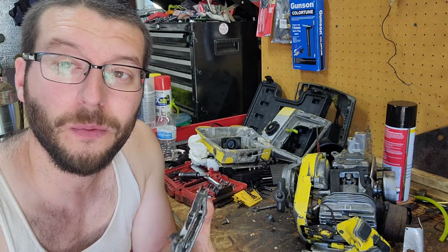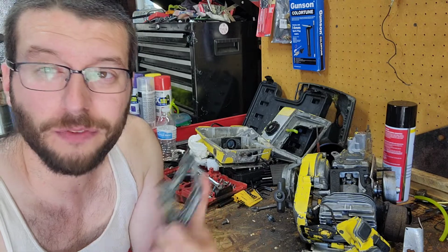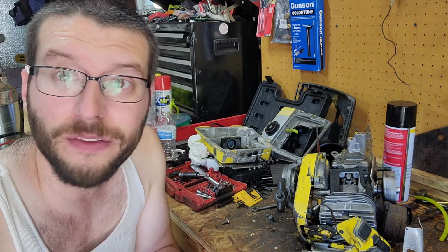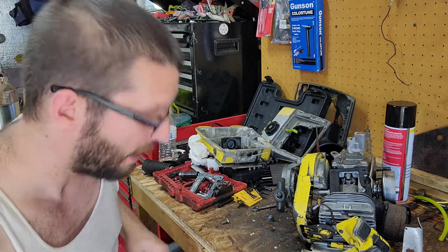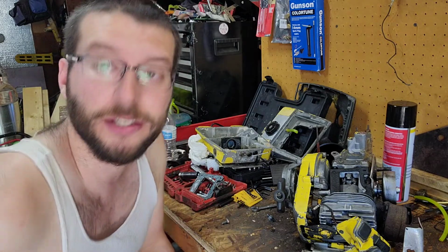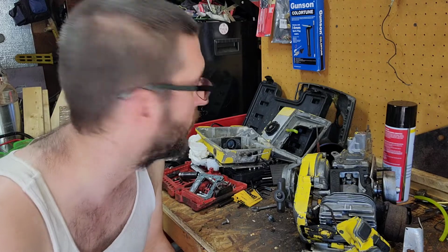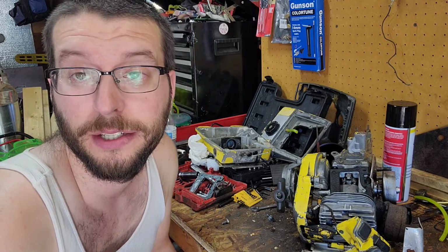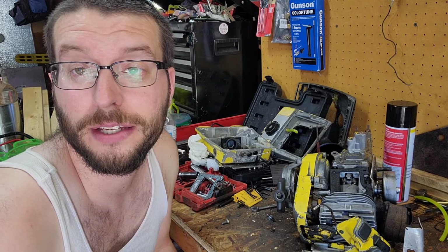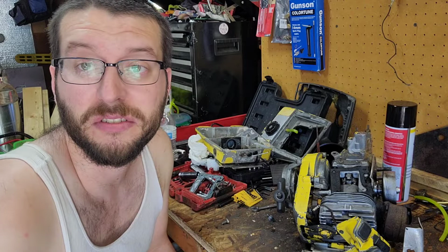The Velcro Care Pack one, it peeled off. But it's a little stronger type of fiber, and I didn't detect any leaks around it either. So it didn't fail there. But when I sprayed on the intake underside, sprayed around the carb, nothing. No leaks on my adapter, no nothing like that. So that wasn't the leak. Okay. Spray on the underside of where the tank meets the block, and it died.